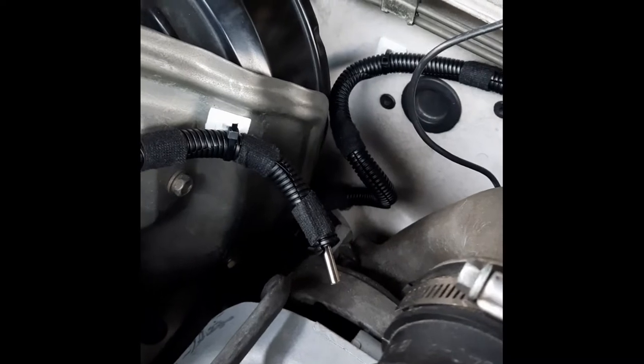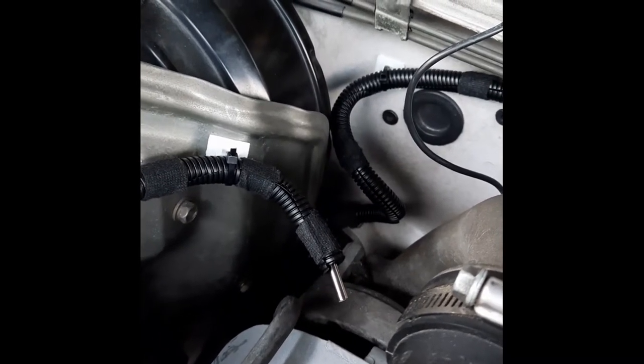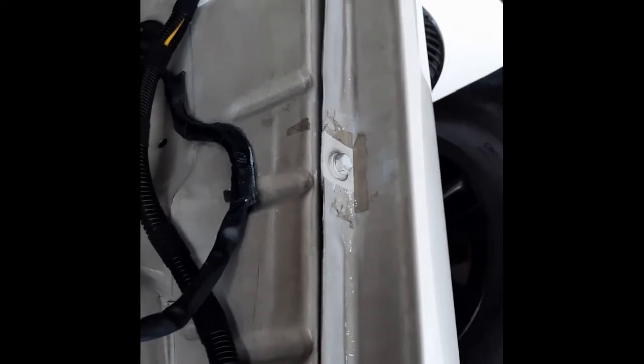So the next step is, I'm going to leave this here first with this temperature sensor over here like that. I will see if I'm getting a good hot reading. And the next round, I'll be installing the brackets and the fuse and the relay and the fans. So one fan will be here, in front of the turbo and distributor. One fan will be below here, sucking cool air from the bottom. And one fan will be here, blowing out the hot air through this little opening over here, right?